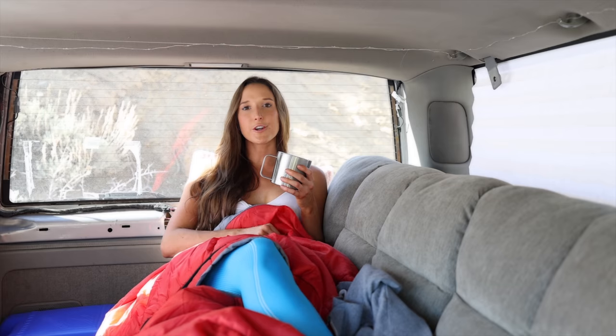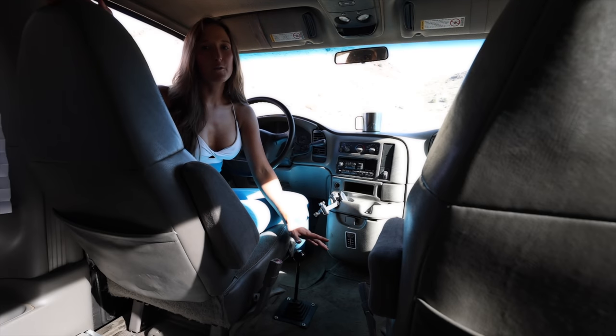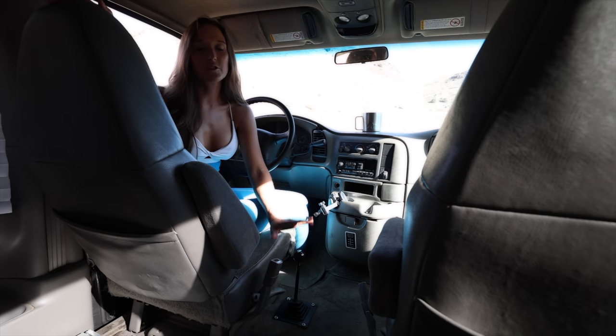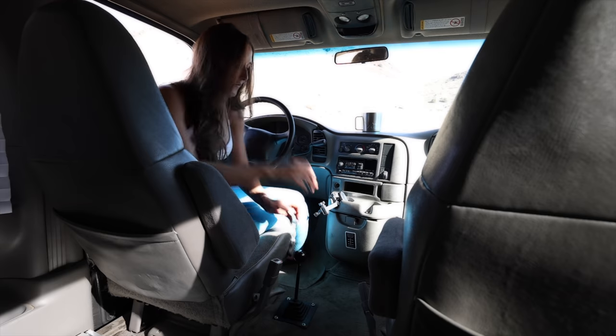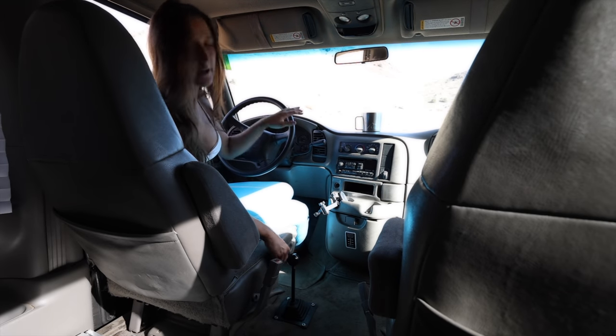Let's get into the details on the conversion. I'm going to crawl up there and show you the shifter and how I use it. This is the shifter I bought from Journey's Off-Road for their 4x4 conversion kit. It's a pretty straightforward conversion process — they have full detailed instructions on Journey's Off-Road, which is awesome. Basically, you just drill a hole through the bottom of the van and the shifter goes right next to the driver's seat. The shifter fully forward is two-wheel high. Pull back one to straight up and down, that's four-wheel high. Pull back one more, that's four-wheel low.